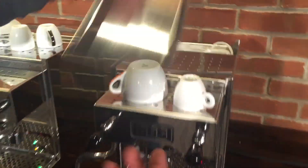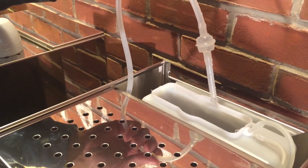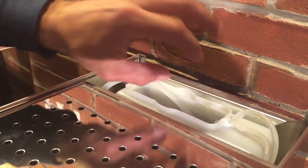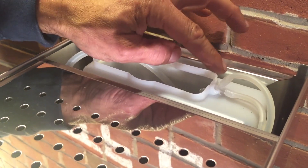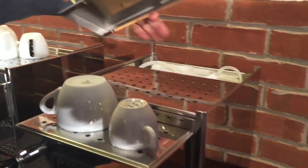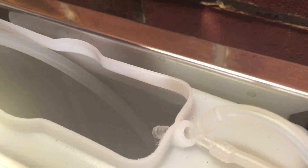Your reservoir is up top. There are a couple — actually three — tubes going into it. Here's your water intake, and it's nice to have a filter on the inlet so you don't suck up little bits of coffee or debris that could get stuck in the valves. Over here you have a tube from your over-pressure valve and one from a deaerator. When you're brewing, you'll always see a little bit of water coming out — that's perfectly normal.